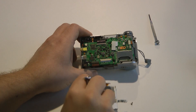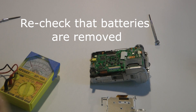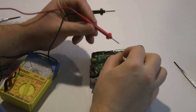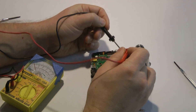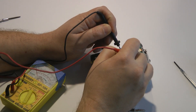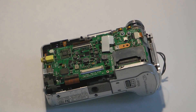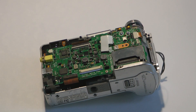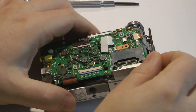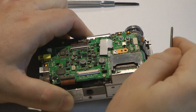You'll find a little piece of tape on the left side — you can remove that as well. Set those aside. You can then use your voltmeter to discharge the capacitors. To do this, pull back on the covering and touch one prong to each of the raised silver tabs. This will discharge your capacitor. We're then going to remove the two cables securing the motherboard to the rest of the unit — you'll find one here and one here. We're just going to use some pressure to remove the cables.